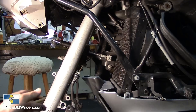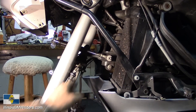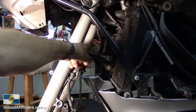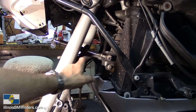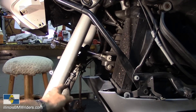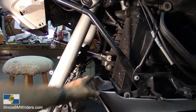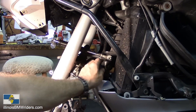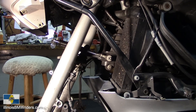I can't remember if I have to remove the rear tire to make more room to fully extend these fork tubes out. Also, watch your brake line right there — you may have to pull it off if it looks like you're putting too much tension on it. There's a little hex screw here and a nut on that side; they just pull off the brackets and then just hang loose. Make sure they're not being overly stressed, especially if you have old rubber tubes like this customer does.